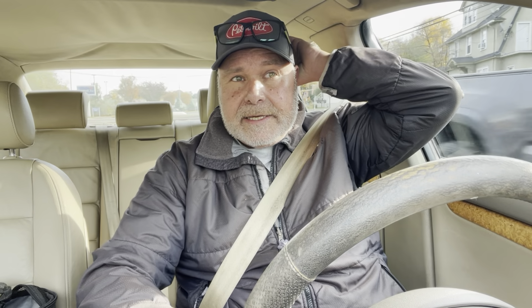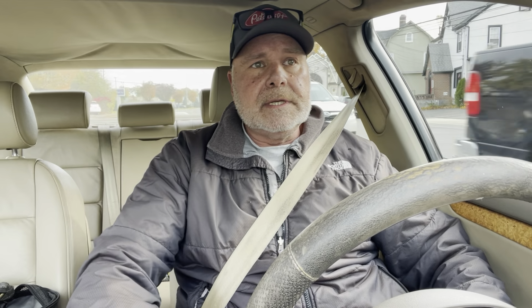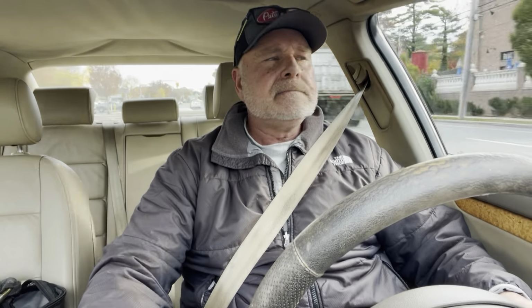Again, I pulled my brakes, both my trailer and my tractor. And I don't like to pull my trailer brakes, especially in the winter, because it locks up, and then at night, with the cold temperatures coming up, it'll freeze. So, a word to the wise: do not pull your trailer brake only at the shipper or receiver. You're fine, nothing's going to happen. Just use your tractor brake.